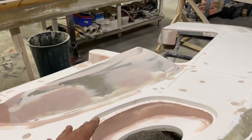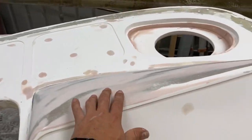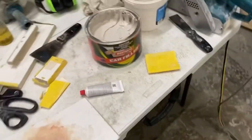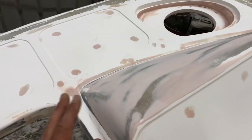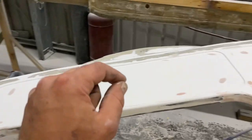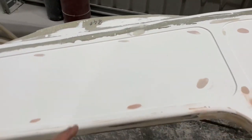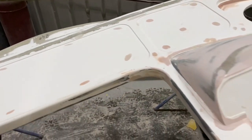And once I do the high build, which is an epoxy high build, I can't use the polyester bog car filler stuff because it won't adhere to the epoxy properly, and I know that from doing it in the past. Even if you just do little fill up bits, it looks fine, but after about 2 years it lifts up in that spot that you do.